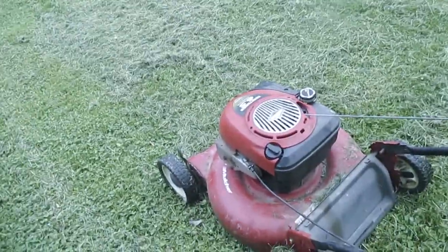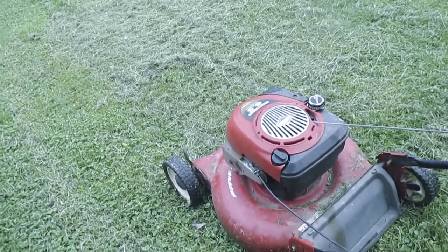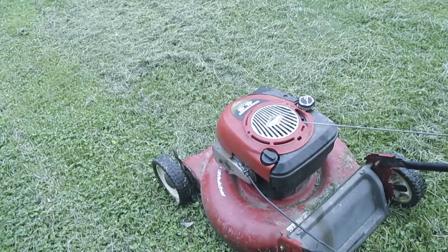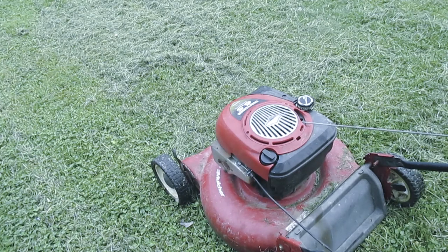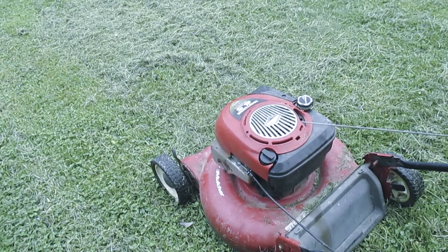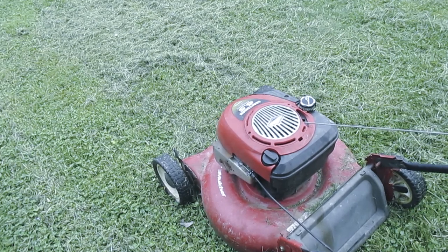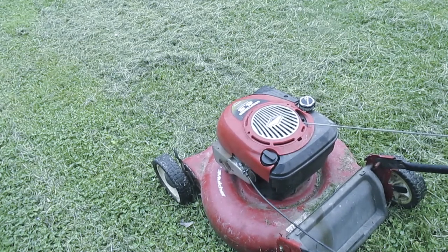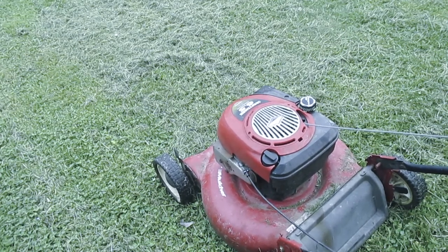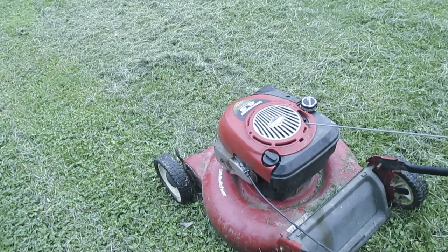But whenever you put that on, it basically brakes. Whenever this thing goes up, you have engaged an engine brake. Whenever it's going down, you disengage the engine brake and you will start that engine. But with it up, you see, this thing is never going to start. This has tension, and I'm going to probably break the cable. With it down, I mean, it's as easy as cake.